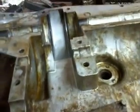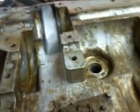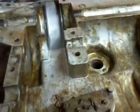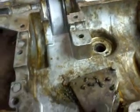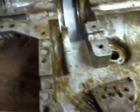But if you do want to convert your transaxle over to gear oil, use 80W90. That's what I use in my old farm tractor. It's a 1947 Ford 2N, in case you didn't know. Originally Ford called for the 80W90, so that's what you can use in this too.